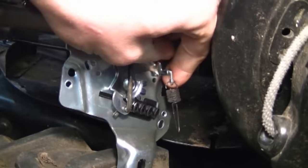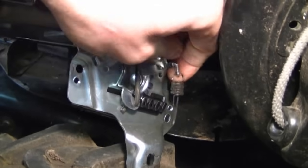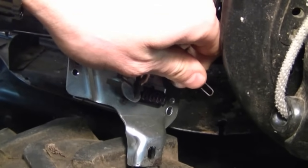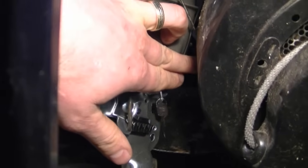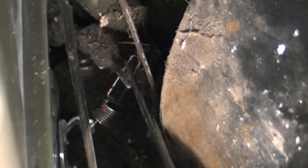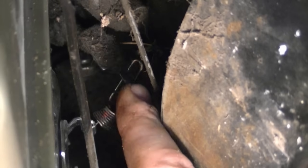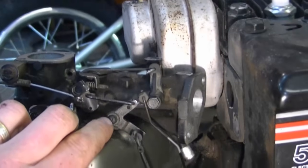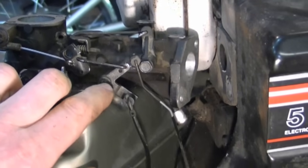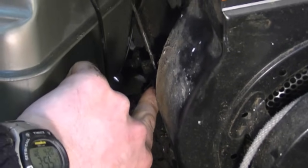You'll notice a little spring here that's hooked up to this part of the mechanism. It hooks in this way with the fat part of the spring onto the fuel tank. Now we have to connect this other end of the spring onto the governor system on the engine — it connects right on here. You want the spring to be connected this way so it slides up and down this clip, because when you throttle up and down it's going to swivel with it. So you put it in like this. Once you've got it clipped in like this, reinstall your fuel tank and make sure it doesn't come off this clip.